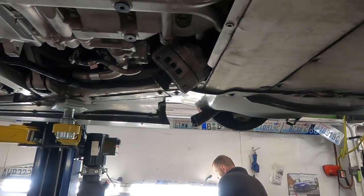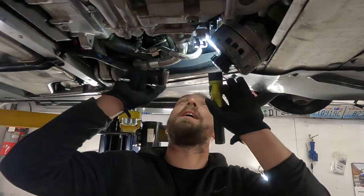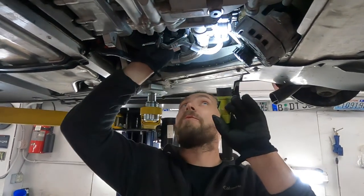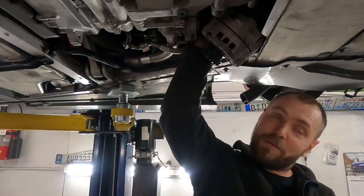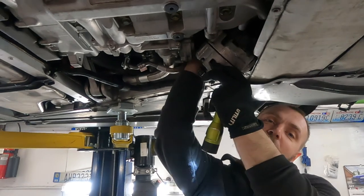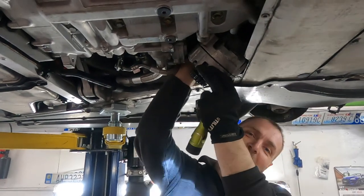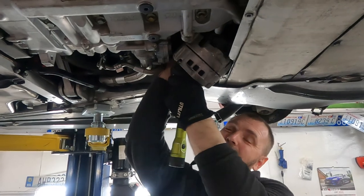It's a little bit difficult, it's not that easy, but I saw some short marks. Whoever did the downpipe installation maybe did it for the first time, and they shorted ground to the battery. It's a funny thing. Let me take out the bolt. They did not disconnect the main power cable. I saw this a few times. Short to ground? Yeah. That sucks.